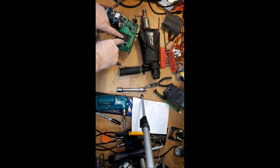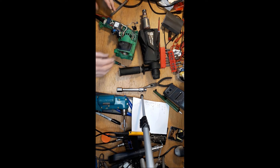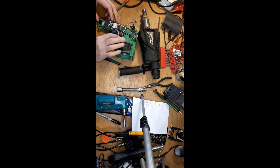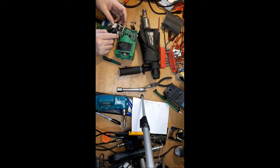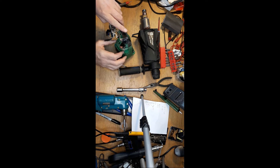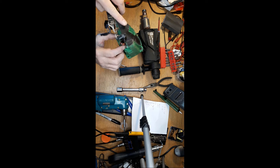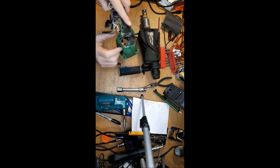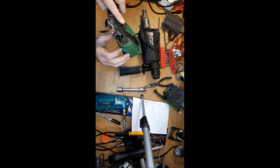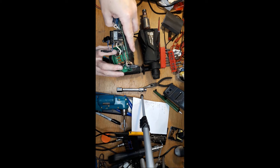So, field coil - well that's split in two. So we have to just find the two connections coming off each side of the coil - two separate coils. This one came from the drill. We've got one half coil here and the other half of the coil is over to the side. Looking over there we've got like a grey wire and a white wire.